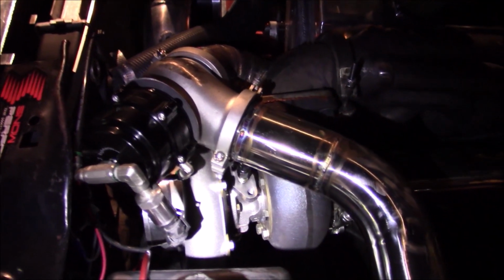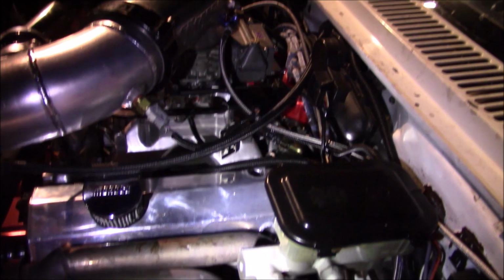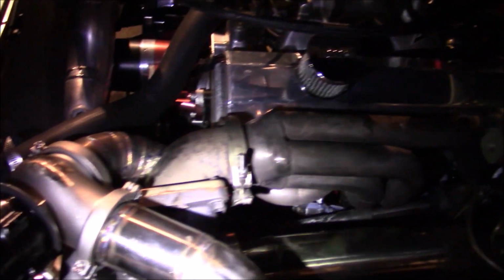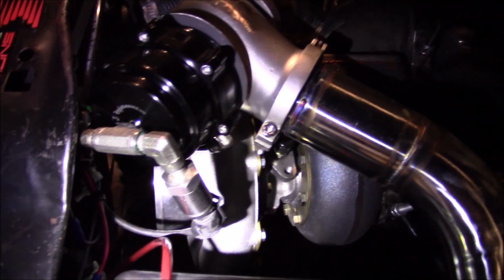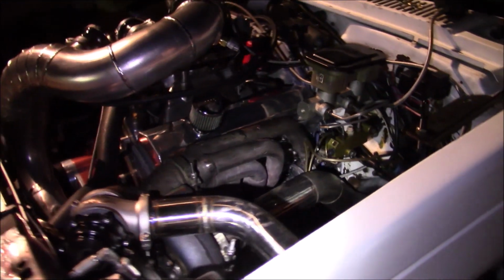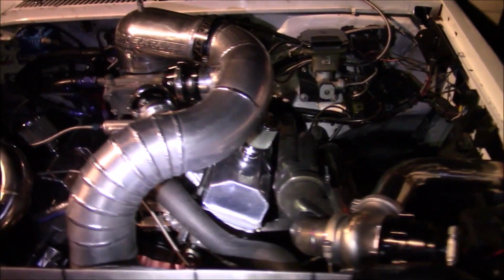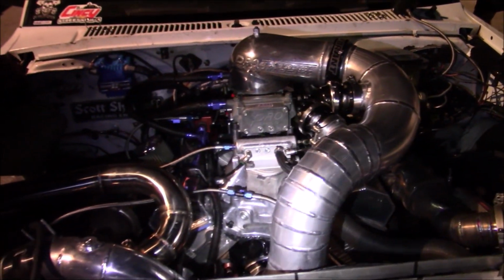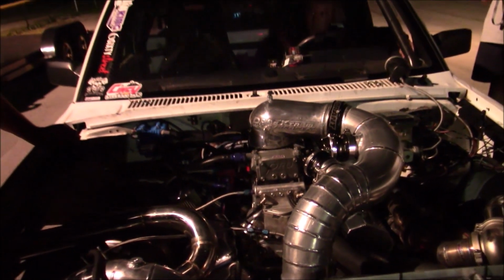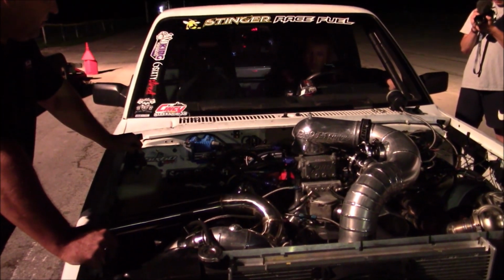That's just the way it sounded. How much bottle pressure do you have? It's funny, it's in the green. Well, in the green, because you're going to have to turn the dome pressure way up on those gates to hold them shut. I could hear it about midway through low gear. It started to open the gates or something because it just started to lay down. It just didn't run. It sounded flat in high gear, just like it wasn't on any boost. Yeah, I didn't feel like it was on anything.